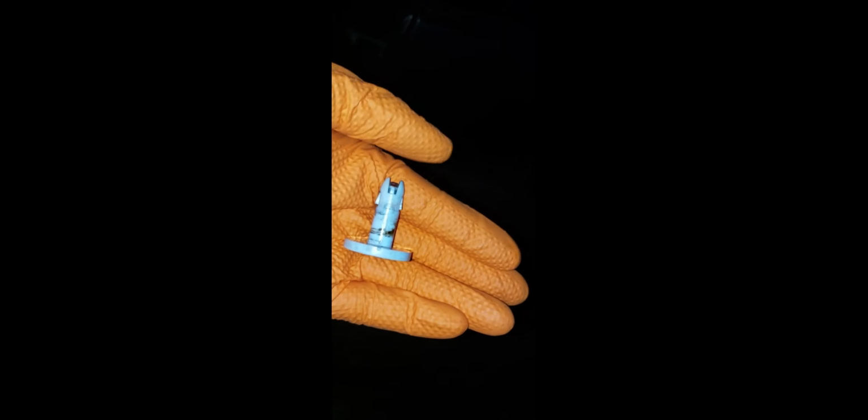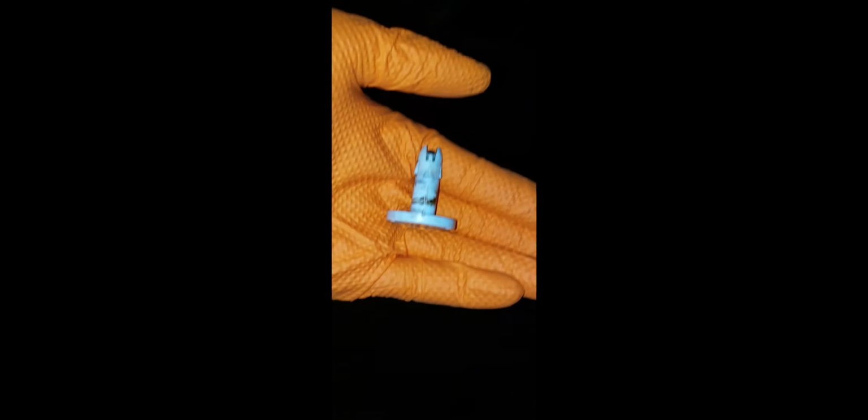Also, one more thing I want to bring up in regards to this piece. If you have a hard time actually pushing these tabs in because you feel like they're pressed up against the metal backing that they're going to be next to, just push it in this way. Push from the top, so this flat piece that looks like a washer is up against its housing metal. That way you can relieve the pressure from these points here. Once you do that, it should be easier to squeeze these down, because sometimes if this gets pushed as you're jostling with it, these little barbs will get pushed up against that piece of metal on the other side, and it'll make it a little tough to push them in because they have pressure on them.